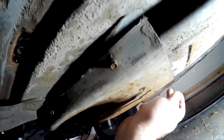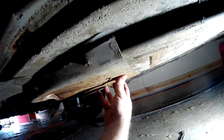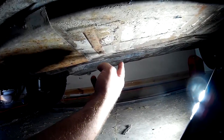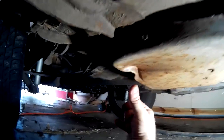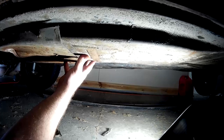It's fine — most of the original metal is actually still there. Now I just need to decide if I want to repair one side, do quarters, or just do both sides. Because even though the driver's side is pretty solid, it is beat to heck. I don't know if they went off-roading in this thing, but I can tell they used a jack in the wrong place. There are spots where you can tell the jack was used and it's deformed the metal. This is all bent up, and same thing goes for the other side. Once I get everything apart and get a better look, I'll be able to determine exactly how deep I want to go with the floor pan replacement.